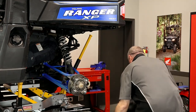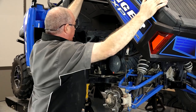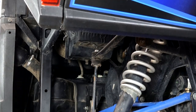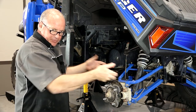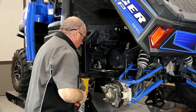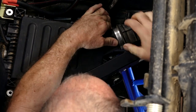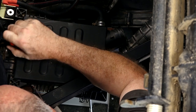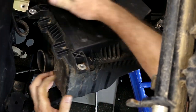Alright, we've got our wheel out of the way. What I want to do next is go ahead and tilt the bed back, because what we need to accomplish is removing these three screws holding in the airbox so it can get up and out of the way and clear the actual cover. And then, as Polaris suggests, take off this zerk fitting as well so it'll come out smoothly. Just three 10 millimeters up toward the front and then this one from the side. Now loosen up the clamp heading back to the throttle body, remove that hose, and let it hang. Now we can lift up the entire airbox and lay it up top to get it completely out of the way.